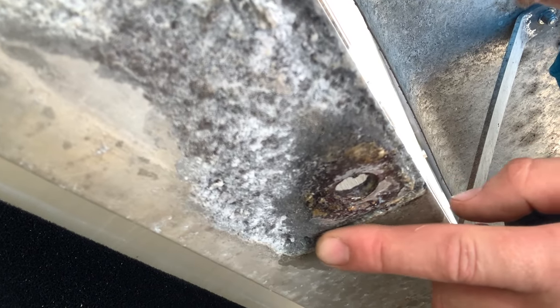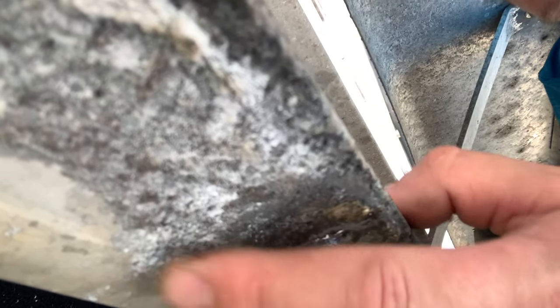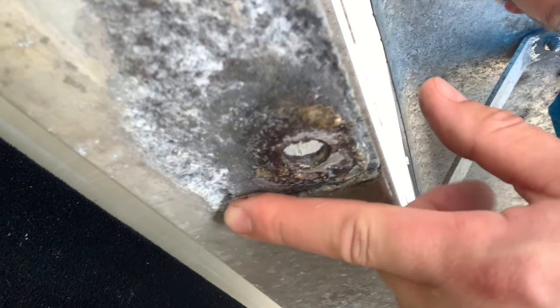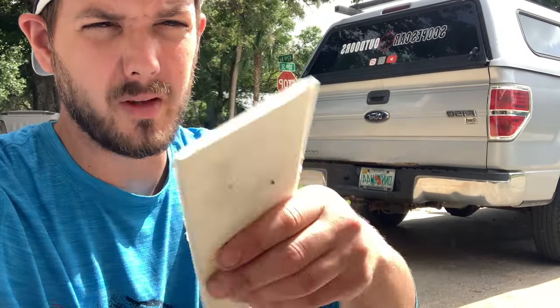Today I just hit that on an angle — that gives me some more leverage on it. This is all corroded, oxidized — that aluminum has gotten eaten away. I've seen where people will take an aluminum bracket spacer and put it between the axle and the frame to prevent that from happening, but when you think about it, why use aluminum? Aluminum corrodes — it would corrode the same way and then you just have a spacer. So I'm going to take this starboard — I cut a chunk of it, took it on the table saw and sliced it down and made a little thinner piece, made two out of one strip.